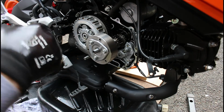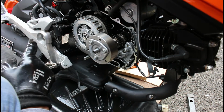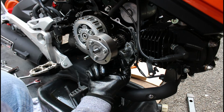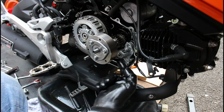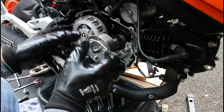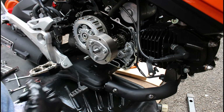Right, so I'm about to put the casing back on. The single most important thing to remember before you do that is that you remove your 2p or 1p from underneath here that you've used to lock those splines in. That will hold and you won't see it in there, so don't forget to remove that before by turning this anti-clockwise. That will release that 2p, drop it out.